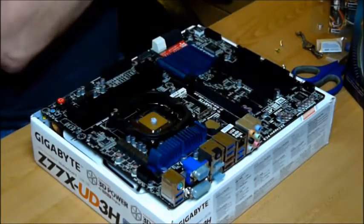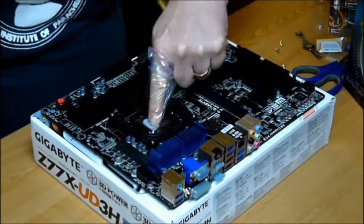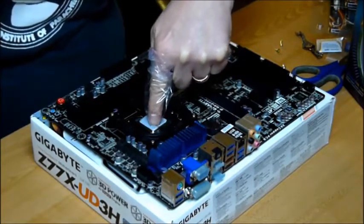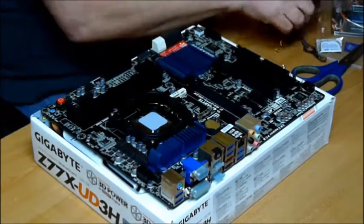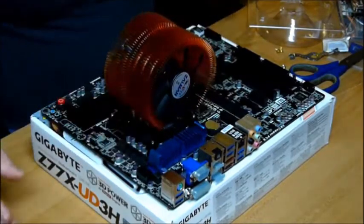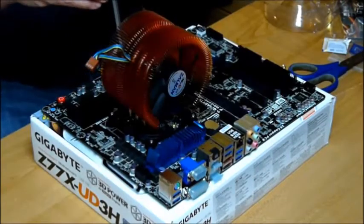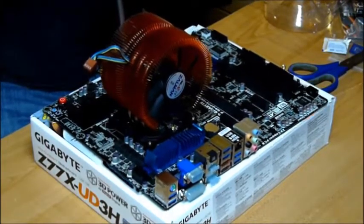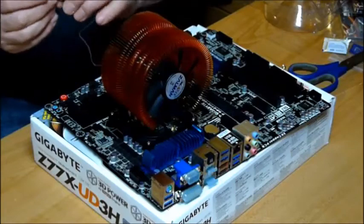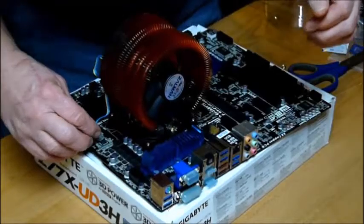Take a plastic bag, put your finger in the bag, and smear it around so you get a complete covering — because we don't want to suffer from any thermal issues. The next step is the beautiful fan itself. We gently lower the fan onto the CPU. Plug the fan 4-pin into the 4-pin header on the main board. Fan installed.